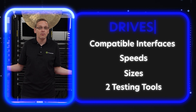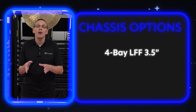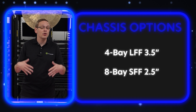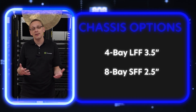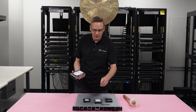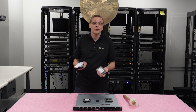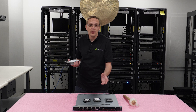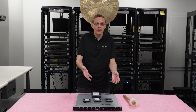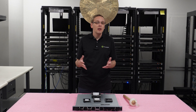Really the first thing when it comes to drives is: what chassis do you have? There are two types of R360 chassis. One is a 4-bay 3.5-inch large form factor chassis, and one is an 8-bay 2.5-inch small form factor chassis. So depending on the type of chassis you have will determine what types of drives you can use. If you look at the front, there'll either be four bays or eight bays. If it's four, it's a large form factor; if it's eight, it's a small form factor.